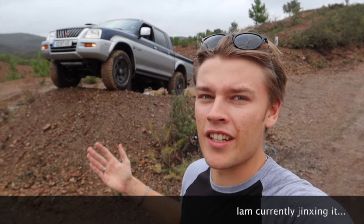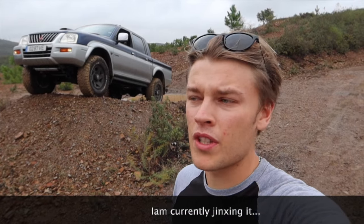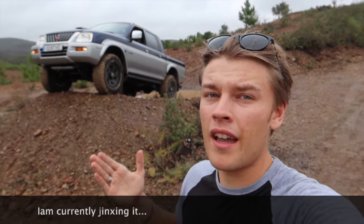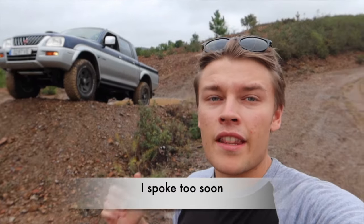I've gone for a little test drive all the way up the mountain. I've driven it flat out all the way up here as a serious test. It spikes and comes back down but that's a turbo thing — that's what happens on all turbos. This seems to have cured the problem; I haven't had a full over-boosting problem yet. It's just gone up to 15 and back down, where before it would go to 20 and stick at 20, which was ridiculously high — that's in PSI by the way. The truck is running really, really well.